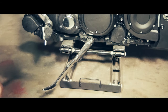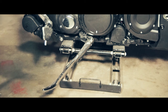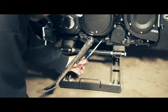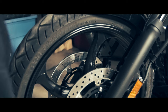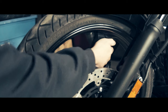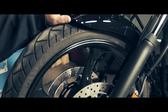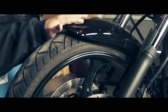A note about balance: this is basically your Harbor Freight motorcycle lift. The balance point is right behind the kickstand nut. The first part is you've got to make sure that you position your wheel so that you can access the bolts to remove the front fender.